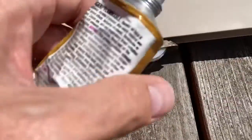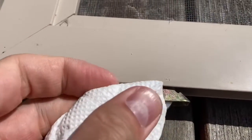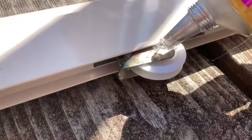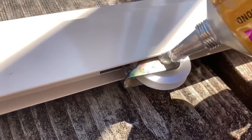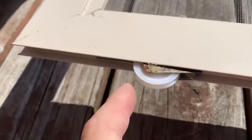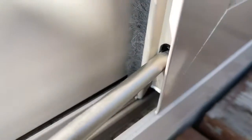Now to prevent this from happening again, we're going to take a little bit of glue and actually glue the plastic axle piece to the metal — just a little bit of glue right there, heavy duty outdoor glue. I'll put a link in the description below for the stuff I recommend. That allows the wheel to still spin freely but it's going to prevent it from sinking too far inward into the door.